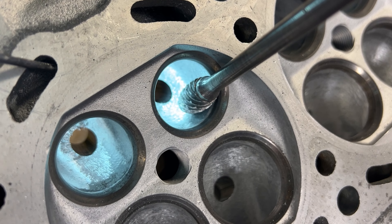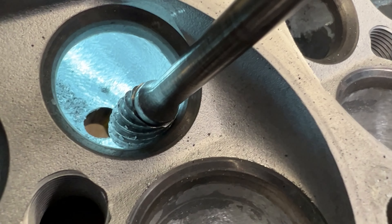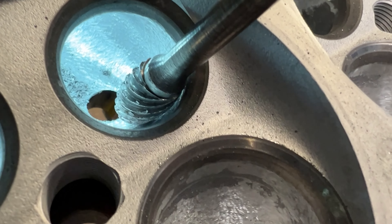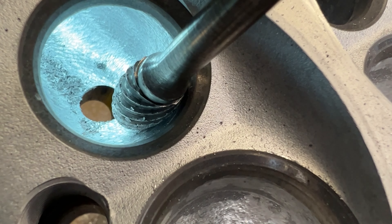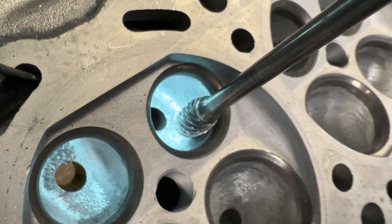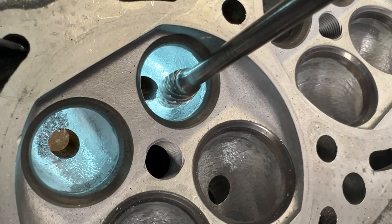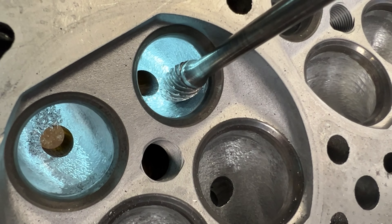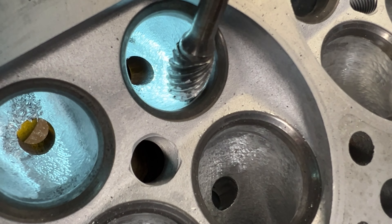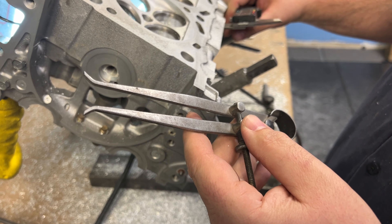You see where it didn't hit? I want to show you that if you use your grinder correctly, you see how it would hit the seat if you tried to make that angle. You don't want to dig everything out — it's really just not needed. Most likely it's already too big and you don't want to make it any bigger. Everything does not need to be touched for you to say you fully ported it. There's no real reason to stick your burr up just to dig it out. Consistency and shape matter a whole lot more than touching everything.